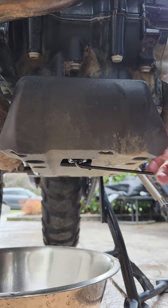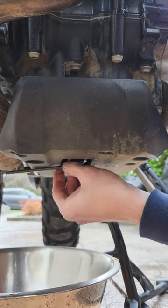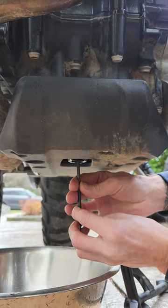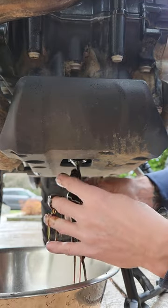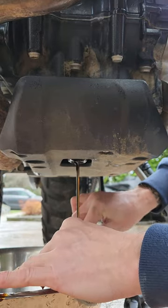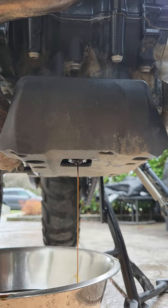Now that the bulk of the oil is removed we can remove the inner drain plug. The oil change is not complete — as you can see there's a fair amount of oil left up inside the second reservoir. If you don't remove this oil plug you could have up to a liter of oil left in the reservoir, and if you try to fill the three liters afterwards you will definitely be overfilled, causing damage to the engine.